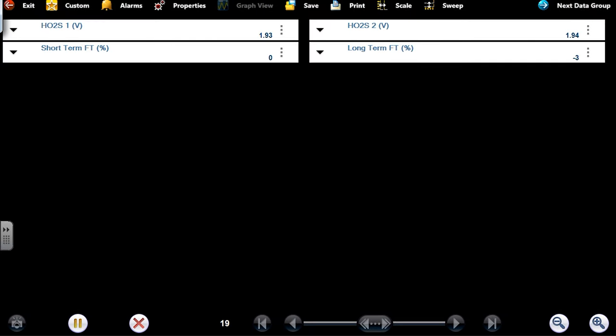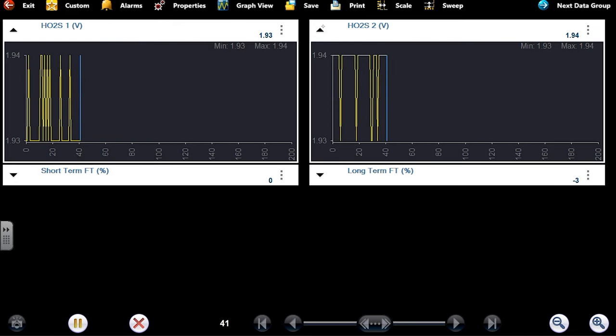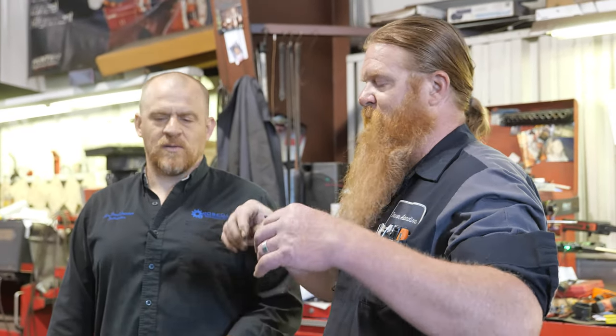Right off the bat, I don't like these O2 numbers. The 1.9 volts. I don't like that. That's suggesting a problem. I have all kinds of intake cam codes, and yes, all those codes are still here. Well, you cleared them. I have an ECT circuit. I had grounds unplugged when I loosened the ground and the computer shut down. You might just need to start fresh.